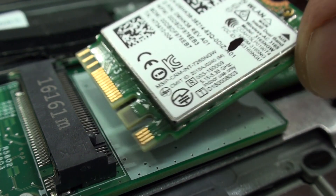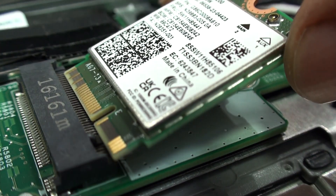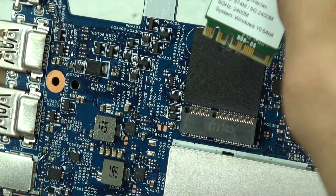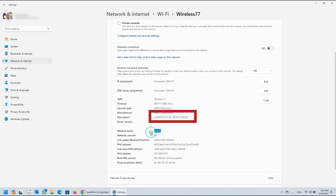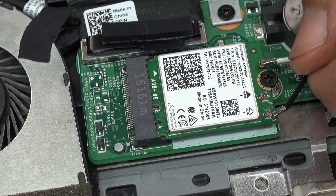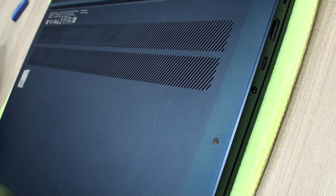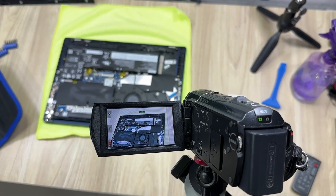An i3 6th generation processor Dell laptop was a long shot and was not fit for such an upgrade. Take a look at this connector — in Dell computers it is much easier to have access to the upgrade slot, but you will not be able to install this card. These keys are actually a way of controlling which add-ons you can connect in different M.2 ports. I was, however, able to install the Wi-Fi 6 card I had on this HP laptop and take it to this Dell computer with a 6th generation i3 processor — it worked fantastic.